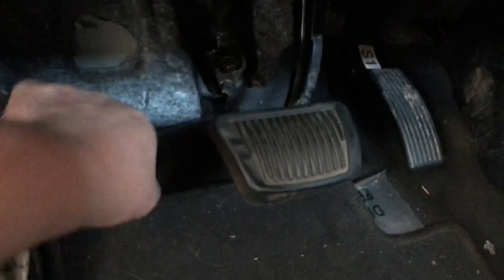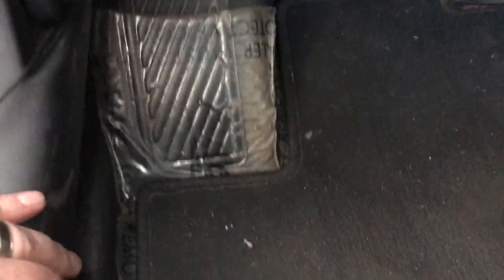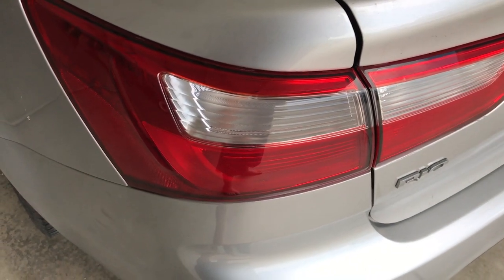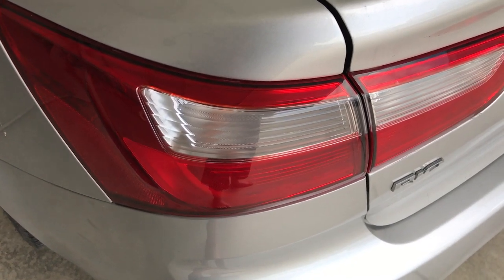We went ahead and ran that cable down, and we just tucked it back up underneath the carpet so it goes straight down, then comes out here. We're going to continue tucking all the way back along — this is the video cable for the backup camera. We've been tucking the wire and we'll continue to tuck here in the back. We need to find access up underneath to the trunk area, because our license plate is down in the bumper area. We're going to tap into the reverse light for positive and negative power for the camera, and to trigger the radio to switch over to reverse mode.